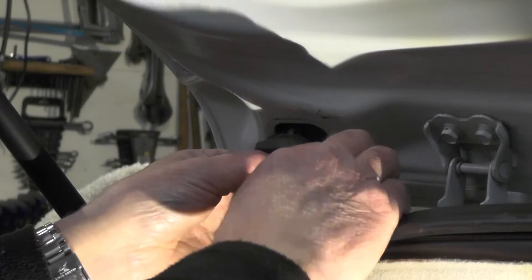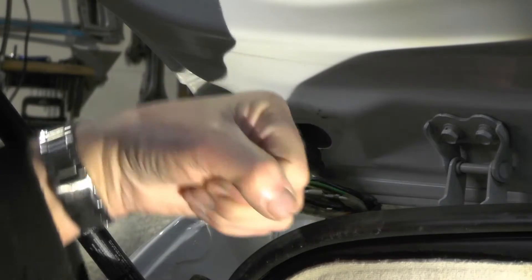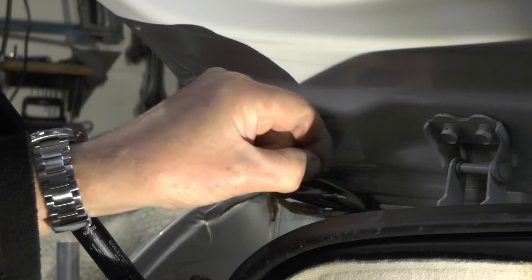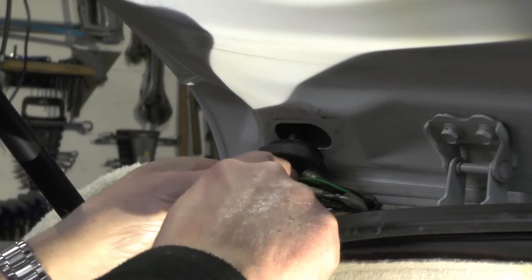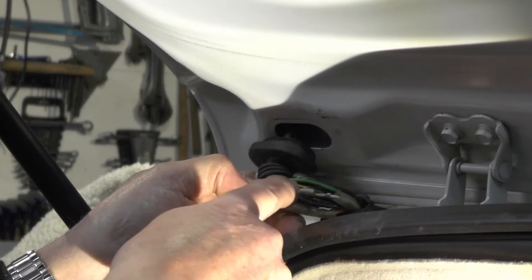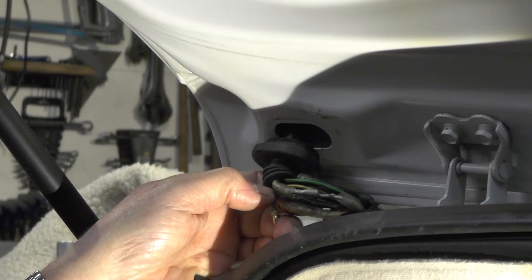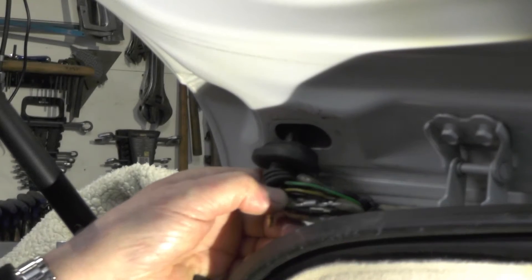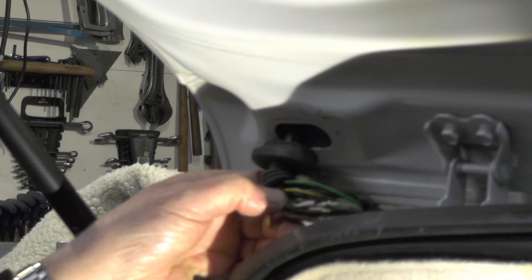To cut a long story short, I traced it down to the problem being here, because this rubber boot is constantly flexing. As you close the tailgate, the PVC around the wires has gone a bit hard, and when I cut into this rubber boot I found that three or four of the wires had actually broke completely. One was shorting out — that was the rear wiper — and on the others that hadn't broke, the PVC had cracked and you could see the bare wires.